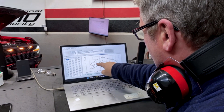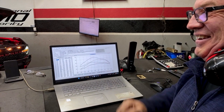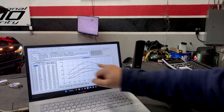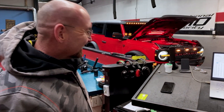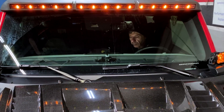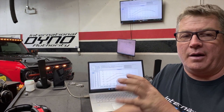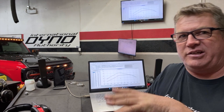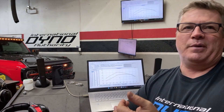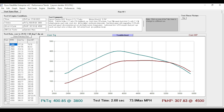Reviewing the torque and horsepower curves, there's a dip in there that needs to be addressed. Wally is behind the wheel working away on building a boost curve, making sure the boost curve and the fuel curve work together and that it's safe. Every time he bumps it, he seems to work his way up. We were at 223 when we came in, went up to 260, then 277, and we just hit 307 this time with 400 foot-pounds of torque, slowly working his way up.